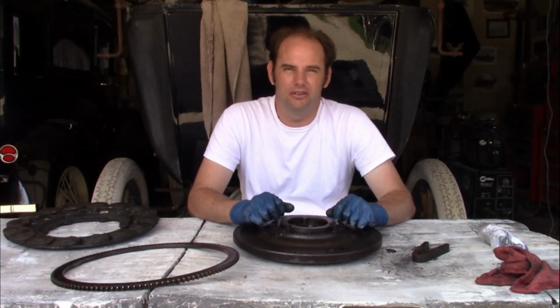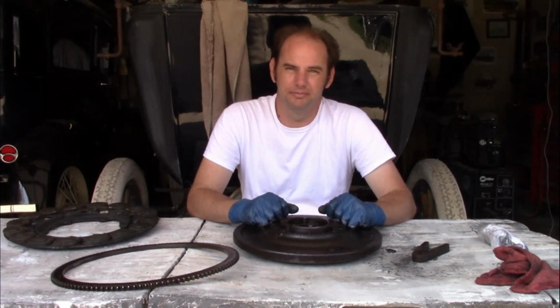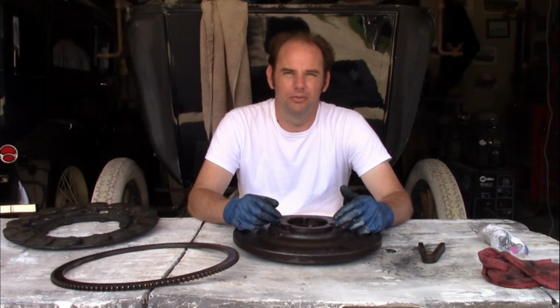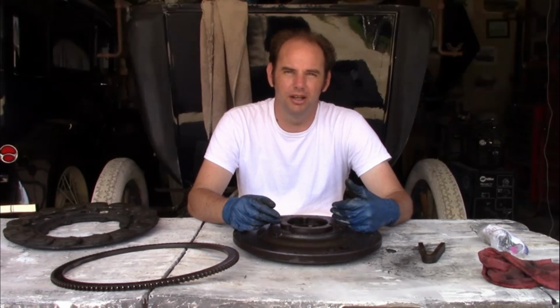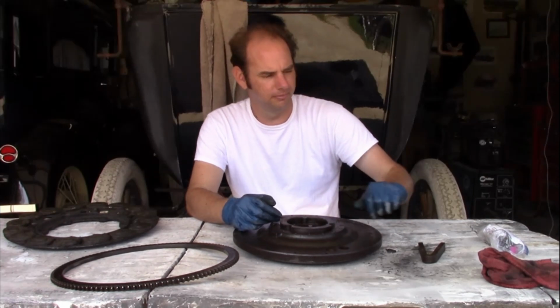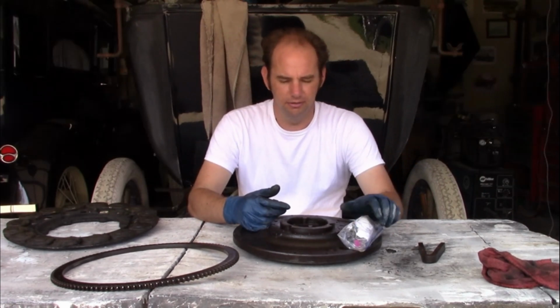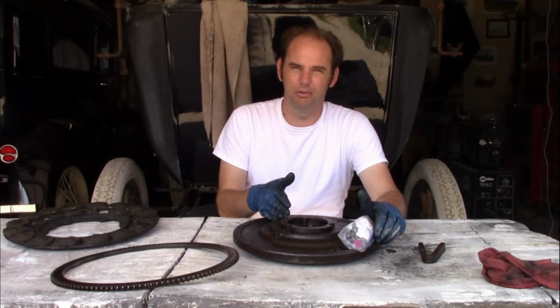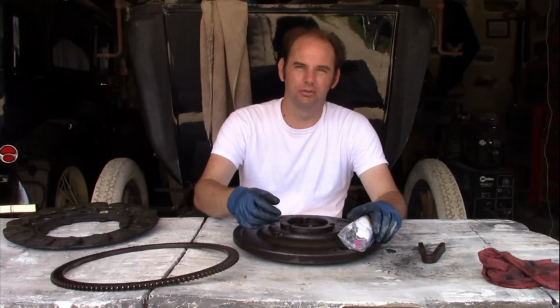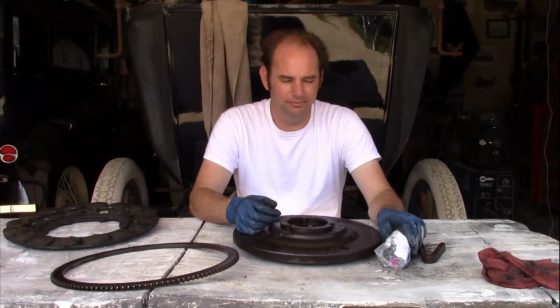Now, when driving this, I'm going to feel a lot better inside if I know that at least that problem can't possibly happen. Now, removing the magnets from the flywheel is a pretty common thing to do because it's a really easy way to remove a lot of rotating weight, which makes the engine rev up and rev down a lot easier. The problem is, there's nothing circulating the oil anymore. So a remedy to that is they have an oil slinger kit, which pretty much is paddles that bolt on here, and it's got additional hardware to hold the ring gear on, which is what I bought and is what I'm going to use on this.